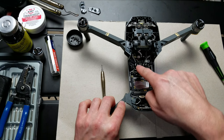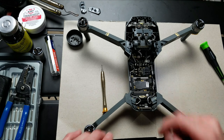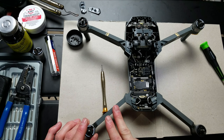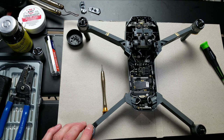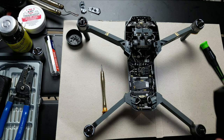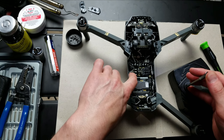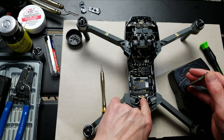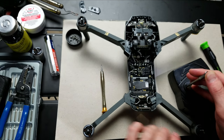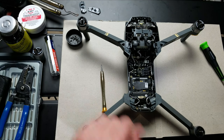We're going to take out these three connections here, remove this liquid tape, and remove and replace this left rear arm. Before I touch any of these components, I want to touch some of the known grounds. I'll take our ground here — it's still off. Touch it. This is a known ground — you can tell by the circle on it. Known grounds everywhere. So now I'm grounded, the aircraft's grounded and bonded, and we're good to go.